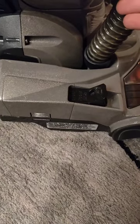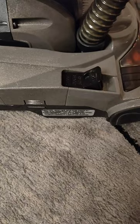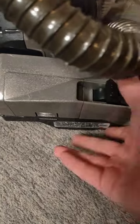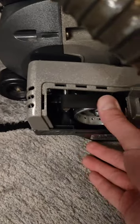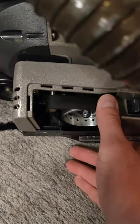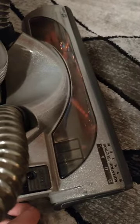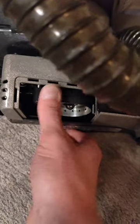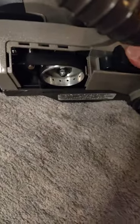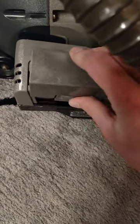Down here, agitator control, basic, well, not so basic, tensioner system on an idler pulley. Actually, let's drop this down so I can try to show you. So here is the main drive belt, motor to main drive, and strangely enough, the motor rotates backwards, not forward like one would think. And if you see, as I turn, it is rotating the brushes opposed. And then once it's free, it spins freely, nothing happens here. Again, I'll post pictures for reference, just for a clearer picture of the operation.